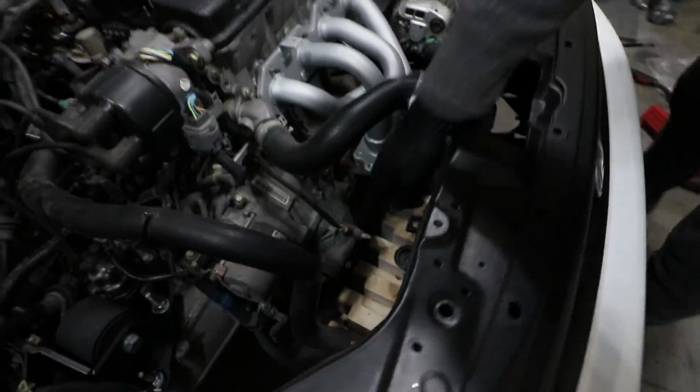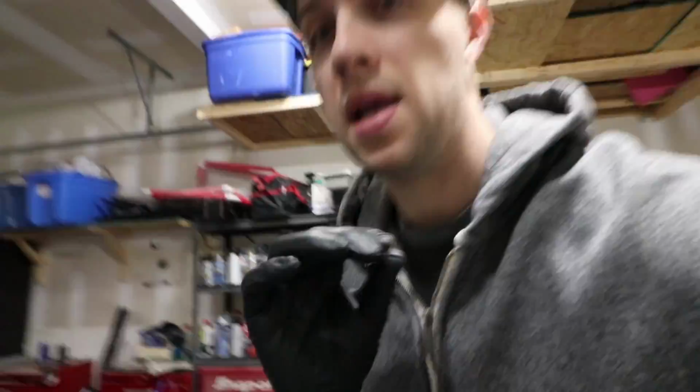Alright, so the next thing I want to work on is getting the stuff that I just unboxed in the video, the radiator and the fan, installed inside the Honda. Basically, I have to take off the front end just to give myself a little bit more working space and not worry about scratching anything. But one thing I do have to mention is the potential issue that the slave cylinder nipple may interfere with the fan or one of the fins on the fan.